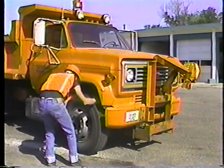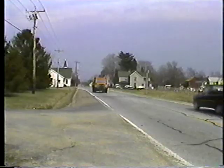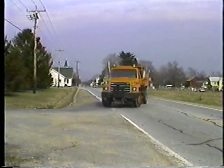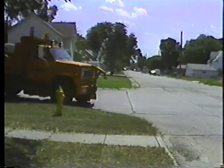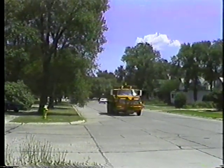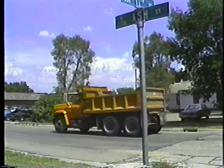Now, turning. Keeping your tires at the right pressure makes it easier to control your truck — check them every day. When making a right turn, don't drift into the opposing lane before the turn, and don't cut it so sharp that you run into signs or over curbs. The right way: signal well in advance, slow down to a safe turning speed, and stay in your lane through the turn. If you must cross the center line, do it on the road you're turning onto — that way you're facing possible danger and can deal with it.